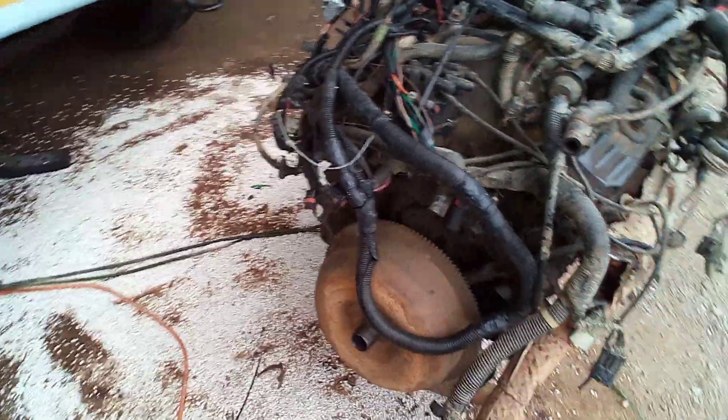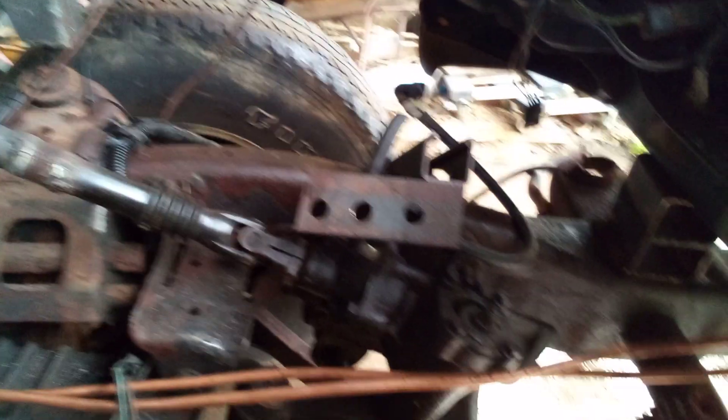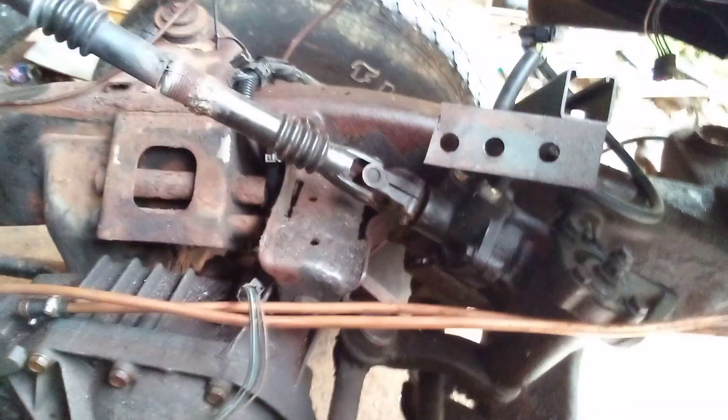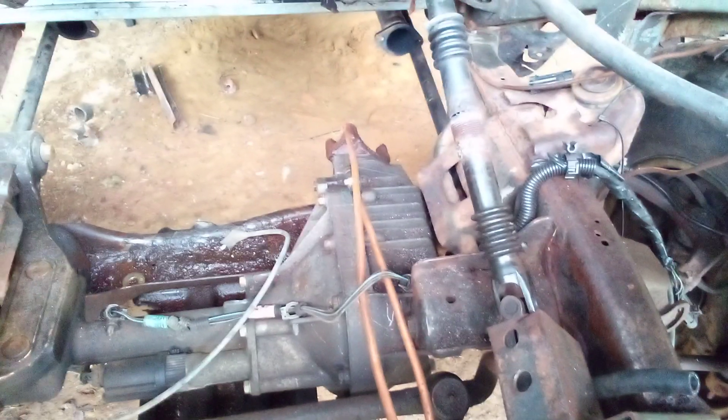You should be able to shove it into a Dodge from like 1998, or a Dodge from 1990 that's got a 1998 transmission sitting in the garage hooked up to the other motor — you get the deal. Here are my ugly motor mounts — this one here's got two points of support and it held really well; they didn't move at all when I set the motor down. I can't put a front support on that one because the starter and the steering shaft are in the way, so I had to take the LS mount off of that side.